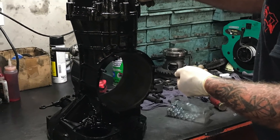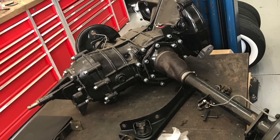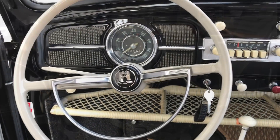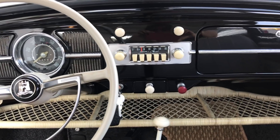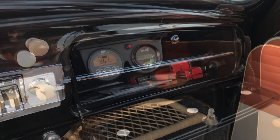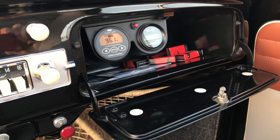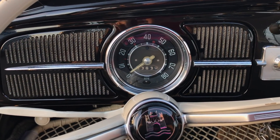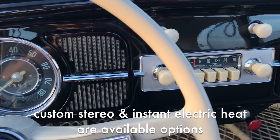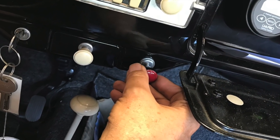This time we re-geared a standard transaxle with just two forward gears to get the most power from the motor. There's a switch on the dash for reverse, so parallel parking, a manual on a hill — it's just super easy this way. We hid our digital fuel gauge and a USB charge port in the glove box. Our client really wanted to keep this car very simple looking, so there's no stereo, no heater, just an AM radio. We did add a variable switch for the wipers, and there's a switch to adjust the regen on the fly.